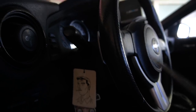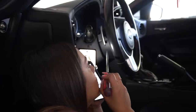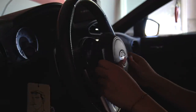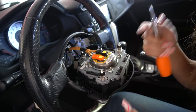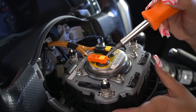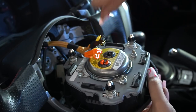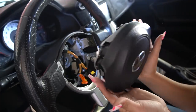There are three clips that you're going to need to take off and you can use a flathead for this. The first one is right here, another one is right under the steering wheel, and the other one is right here. Now that you've got the airbag off, both of the airbag wires and the horn — you're just going to be taking off both of these and all you need is a flathead. Then you're going to want to take off the wire for the horn. There's a little clip for the horn one — just pinch it all together and take it out. Now you've got your entire airbag off, so just put this aside.